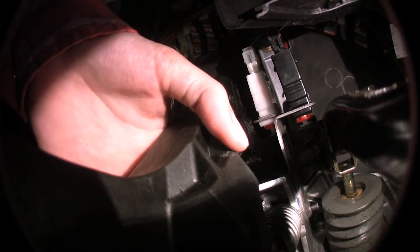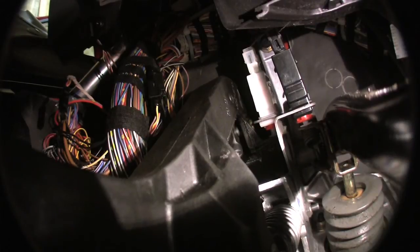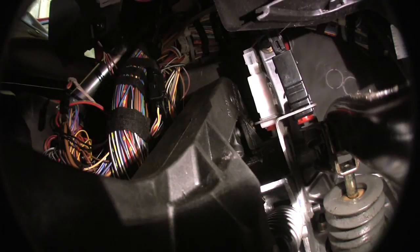At that point, I may try the UUC bushings or something like that to see if I can tighten it up a little bit. This car's always had an issue with a little bit of pedal slop — that's kind of annoyed me. So definitely when you have your clutch pedal out, take a look at what the wear looks like on the plastic itself, because you don't want to wind up doing this twice like me.